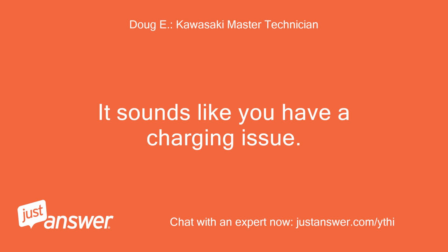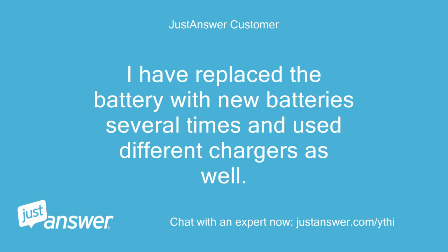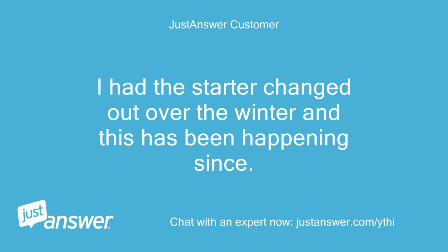It sounds like you have a charging issue. Do you have access to a multimeter or voltage meter so you can run a few simple tests? I have replaced the battery with new batteries several times and used different chargers as well. Does the mower pull power from the battery while running? It quits once it has been running. I had the starter changed out over the winter, and this has been happening since.